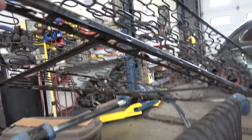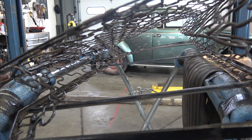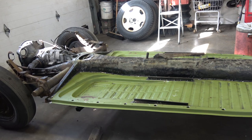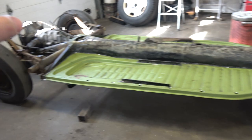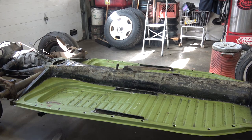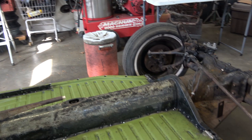This '56 and later frame — take a look — it's all hollow underneath. In the center there are no springs, which is a good safety feature as time went on: you're not going to jeopardize hitting the top of the battery. But those frames I don't believe will work well with these '55 and earlier beetles. If you have this frame going on the wrong floor pan, you could jeopardize hitting the battery because the battery is going to be sitting back further and you could be hitting it — look at these springs, look how they jut down. It's always good to go with the correct stuff so everything fits right.